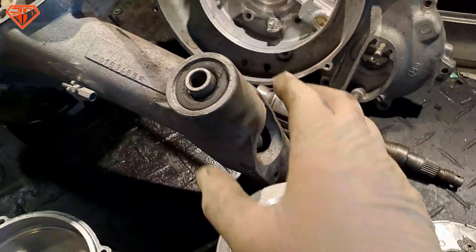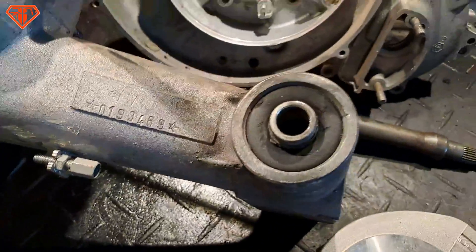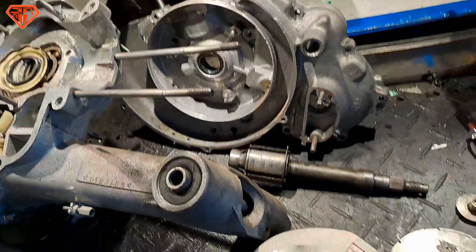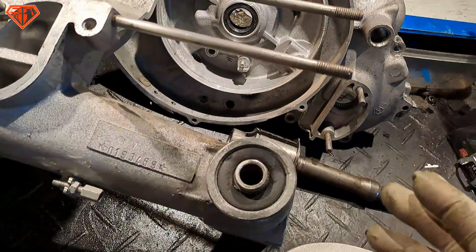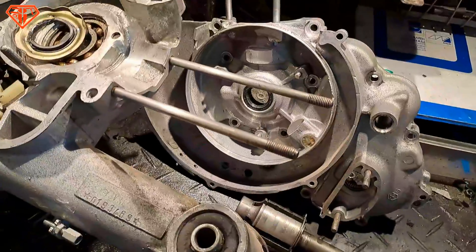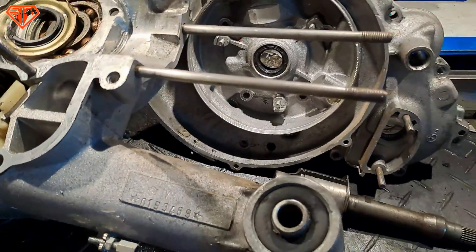I'm gonna proceed with this — the owner was not really aware that it is such a mess. It's gonna be a Malossi VR1. We need a new drive shaft, rivets will be renewed, and a new clutch. It's gonna be a 10-spring with a 24-gear ratio, and we just hope that one day this will run properly. He bought it used, and someone completely messed up this engine then sold it to others. If you screw something up, throw it away, hang it in a workshop on the ceiling — whatever. But don't give it to others. It's essentially stealing money and time. Cheers mates, don't forget to subscribe.